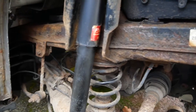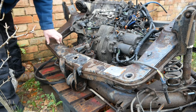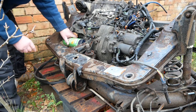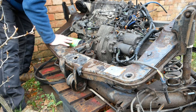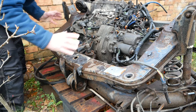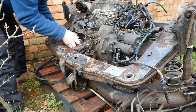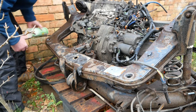There they are — they needed the whole extension. This is the subframe we're actually going to use to convert our smart car into an electric car, to show you where the alternator lives. It lives just down here. I'm standing where the driver's seat is and this is the back of the car. So trying to access that alternator from the back of the car is almost impossible. Hence I've taken the decision to lower the subframe, open up the rear by taking off the springs, the dampers and the cross member, and feed the alternator out through the rear wheel arch. That's the plan.